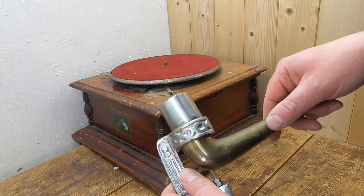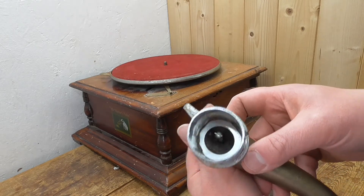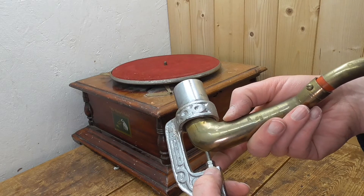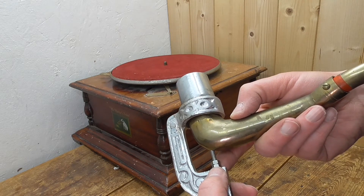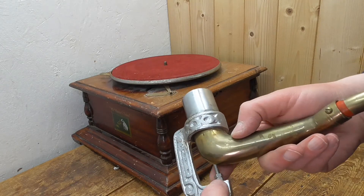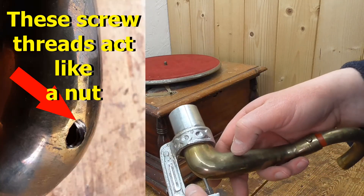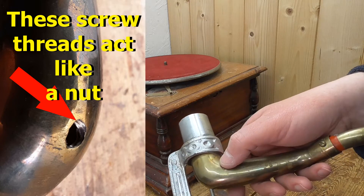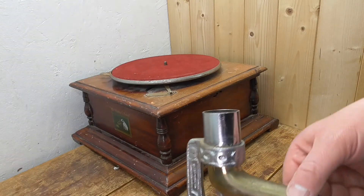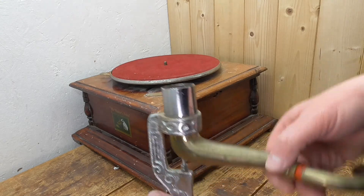You may see there's still quite a bit of slop there, and the problem is that that's inherent in the design. The only thing holding it all in place is that screw in the middle, which goes into a hole in this casting. Originally there was one nut here, and I found another — in fact I found two new ones. I think they're 3/16th British Standard Whitworth. Although that's done up as a lock nut, it doesn't matter, because the screw can still work its way up — it can basically just unscrew upwards, because the actual thread holding it is in the tone arm. So it doesn't really matter what I do with this current design; there's always going to be some slop there. I think I can solve that, but I'm not going to solve that now. For the minute, that's good enough.